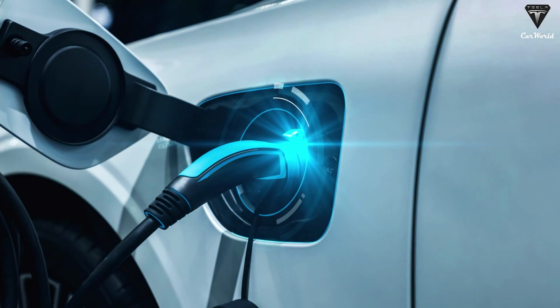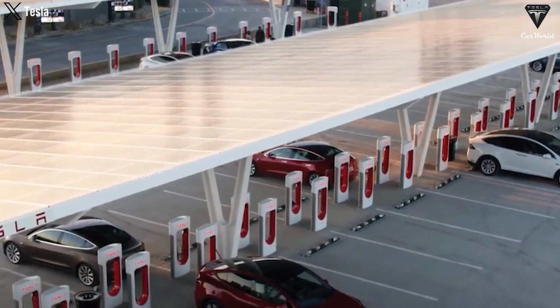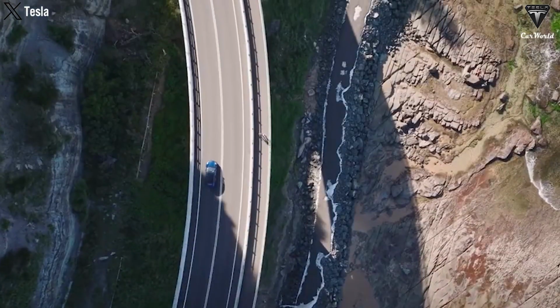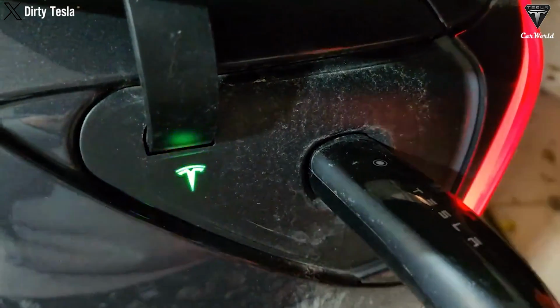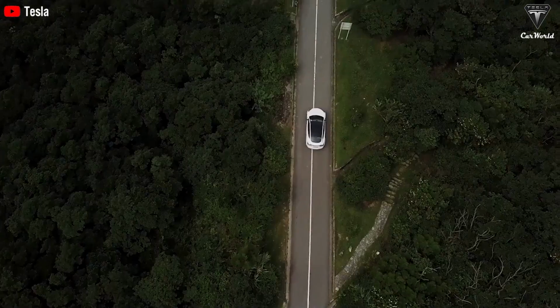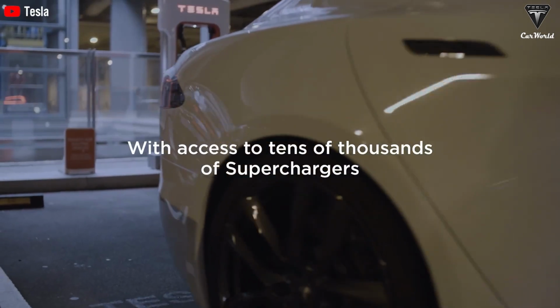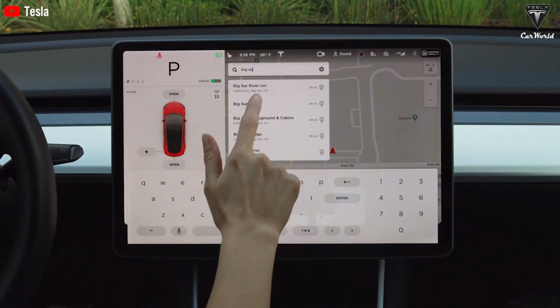According to Tesla, reducing the electron travel distance can enhance the battery's energy efficiency by up to 5% compared to tab designs. Additionally, the tabless design accelerates charging for Tesla vehicles. With shorter travel distances and lower internal resistance, the tabless battery can charge faster and discharge more powerfully. This not only cuts charging time, but also improves the ability to deliver high current over short periods, and that's crucial for EV performance. Tesla forecasts that the tabless design could increase fast charging speeds by 10 to 15%, allowing vehicles using the 4680 battery to fully charge in less than 15 minutes.